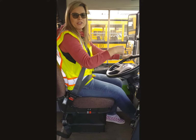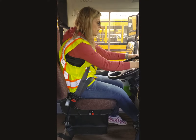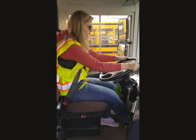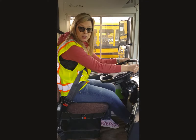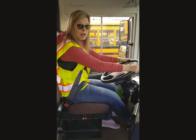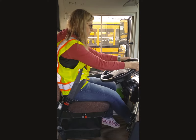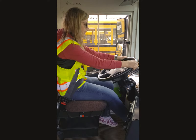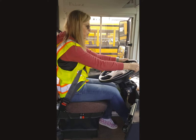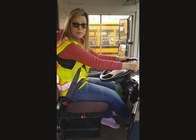Oh hey Mike, you're still hanging out? You're interested in this, right? I think I am. So watch this. Now that I've waited that one full minute, and I did not lose more than 3 psi, I'm going to go ahead and do the lights and buzzers. I'm going to check to see if my lights and buzzers come on at or above 60 psi. There's one — and the second one came on, Mike, and they came on at above 60 psi.